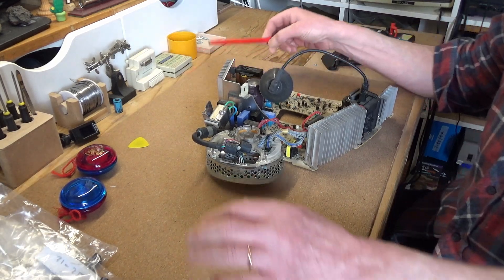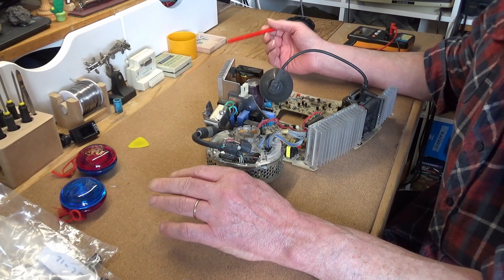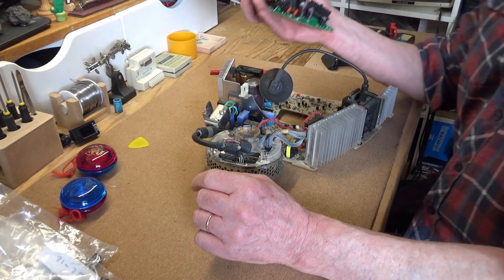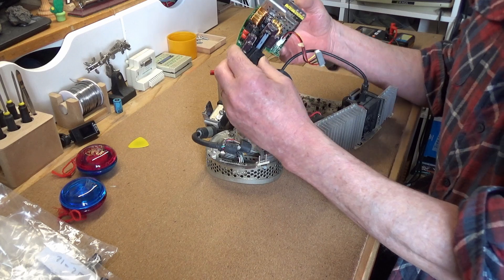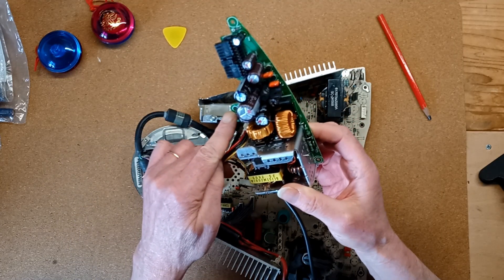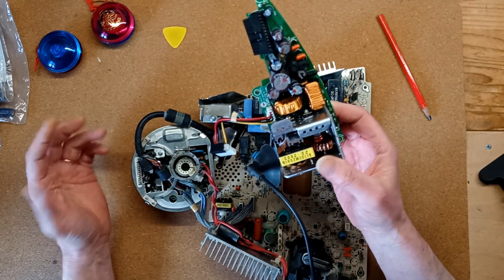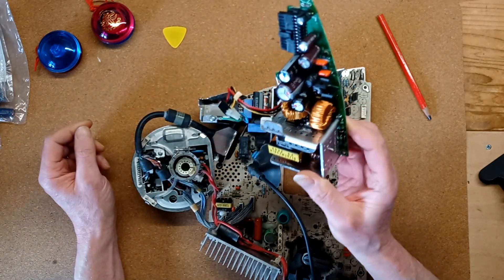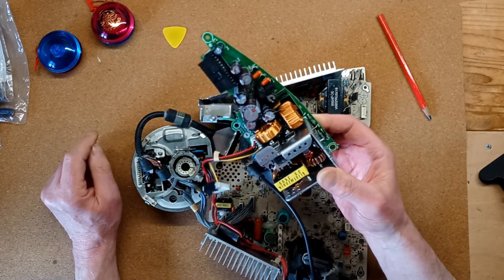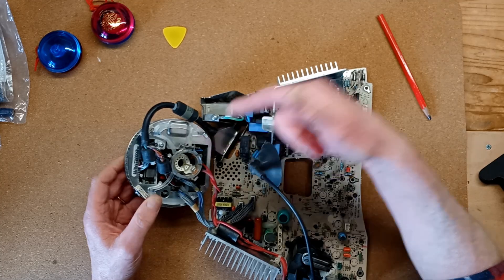As well as the PAV board, if you remember back to the first video, there are four boards inside the G3. There's the logic board, there is the down converter board, which is this one — it is attached to the logic board via a pin here and this connector, and when you remove both together from the computer you separate them at that point. As you can see, there are a number of electrolytics on this board, so I'll be testing these in a moment.